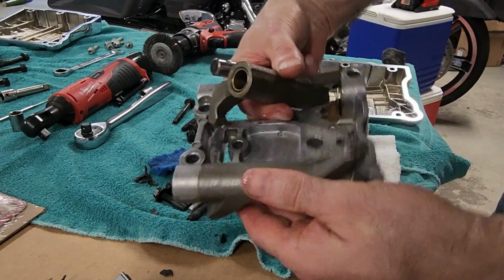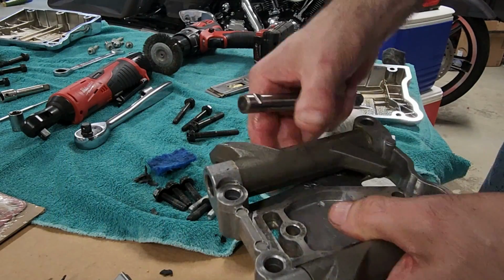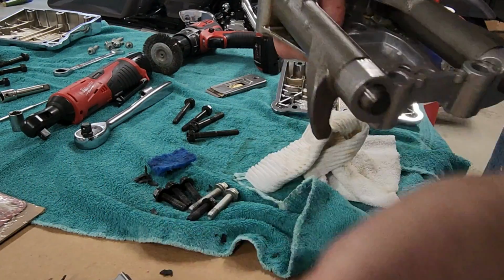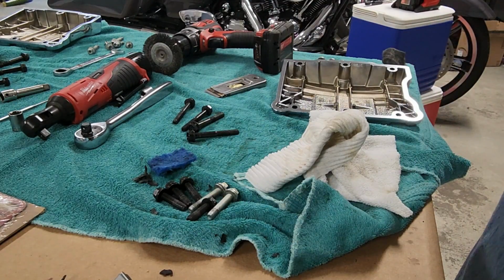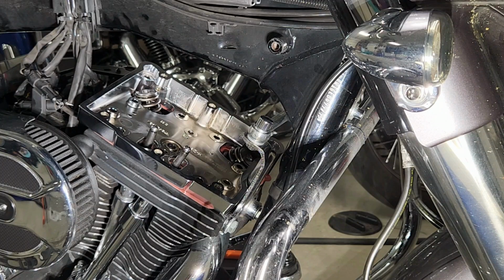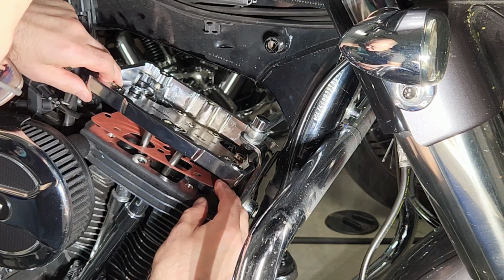So that's important. These support plates have two tiny little holes for oil draining that you want to make sure you blow out so there's no debris blocking those. And every part you're working on, clean it with brake clean. Now some parts I oiled with just 20W50 oil. Some people use assembly lube on the engine parts. I didn't have that available, so I just used some oil. And in retrospect, I wish I did use the assembly lube. I'll talk about that later.